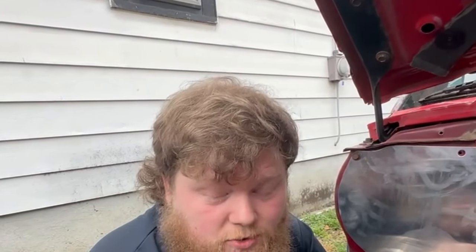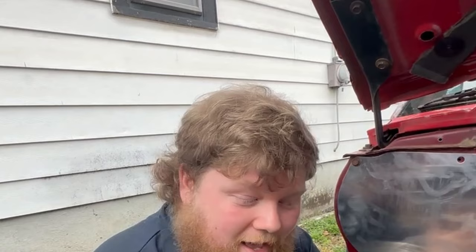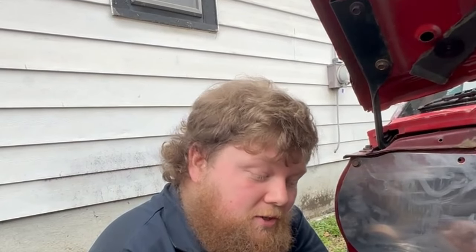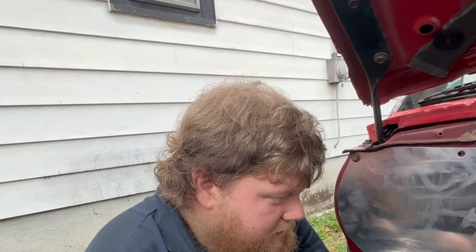And I've also got a shorter water pump I can put on this motor to get me like another inch, I think. You've got a long and a short water pump for these, whether it's a car or a truck. So I've got about 1 1/3 inch basically of wiggle room between that and this. Now what I'm going to do at that point is take the weight of the motor off of these bolts, and I'm going to put a shim or a spacer on either side to take up the space before I put the bolt in finally and torque it before we start driving this thing. But that's pretty much it.